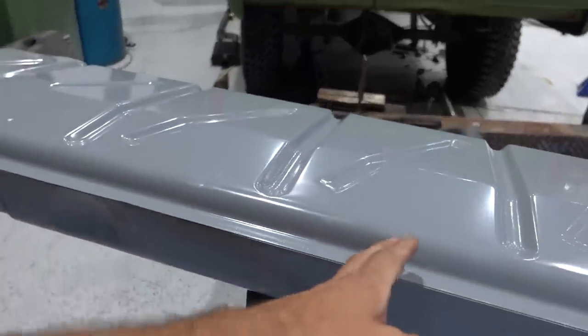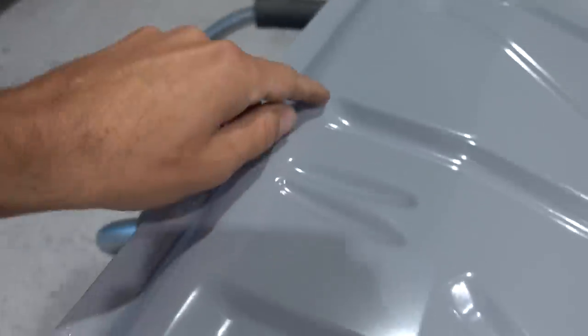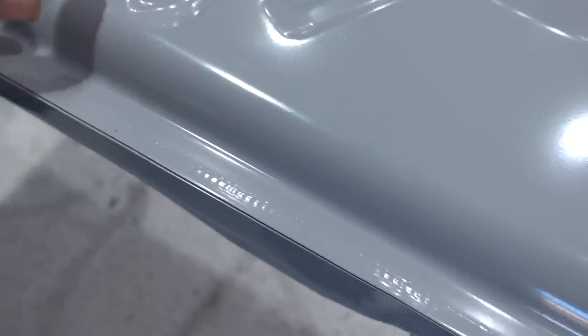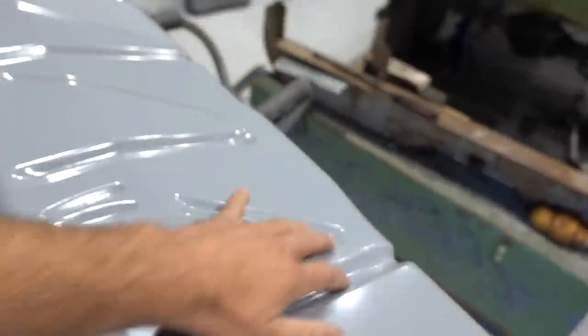Let's go. We're going to find the spot that's dead center of the tank. Judging from the depth of the factory pickup tube, where this tube runs down on the inside, it actually sits off the bottom about 3/4 inch or an inch. So we're going to be below that. Theoretically, we should be as good as or better than the factory pickup was. So we're going to center this thing up, blast some of the primer off of this piece, weld the bung in the bottom side, weld the bung on the top for the return, and we're going to move on to installing fuel line and fuel pump.